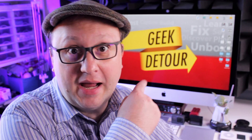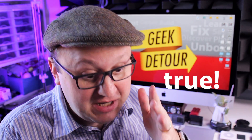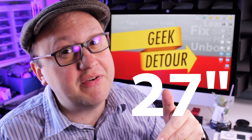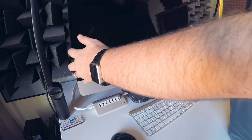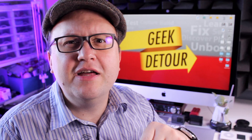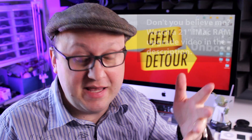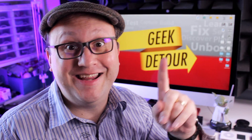One of the main reasons I use a Mac instead of a PC is Final Cut Pro X — it renders videos faster than anything else. By the way, if you are buying an iMac and choosing between the 21-inch or the 27-inch model, trust me, get the big one. Not only for the bigger screen, but mostly for the ability to change the RAM yourself at a much cheaper price than Apple's RAM, easily using the door at the back. The 21-inch iMac requires you to literally unglue the display and disassemble almost the whole computer to access the RAM. You won't. Get the big one with the best CPU you can afford.